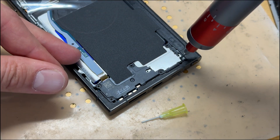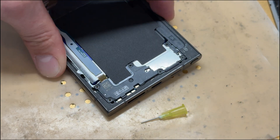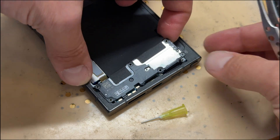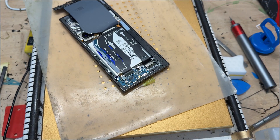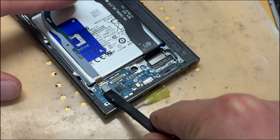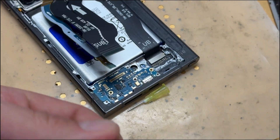I'm using the little supersonic electronic screwdriver to remove all six screws — link is in the description below if you want one. You're going to notice little arrows indicating prying points — safe places to get under and lift up to remove the cover. Fold it and move it out of the way. You'll see one cable there to remove, another cable to remove, and then three more cross-head screws — easy, just make sure you keep them separate from the other screws as they may be different sizes.